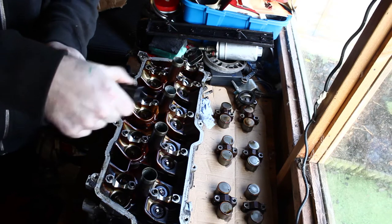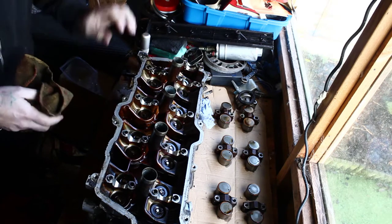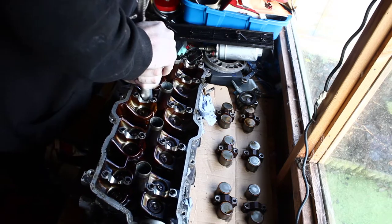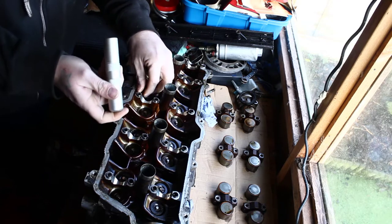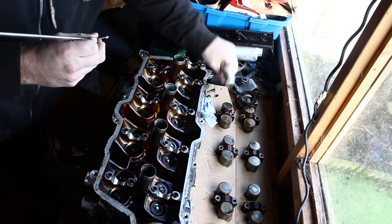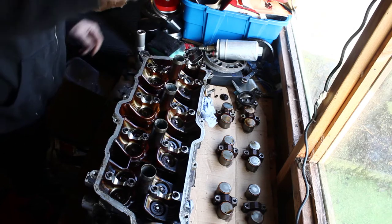So this is the tool I've been using. That is the removal part of it — there's a magnet in there and you basically just put it over the valve like that. I've got to put a rag underneath to stop the valve pushing down. You push down on it, there they go, and it all comes out. Being magnetic, the valve keepers are down in there. So I take another little magnet and take the valve keepers off and remove them.